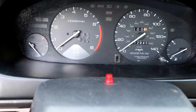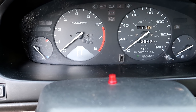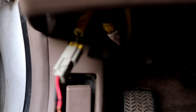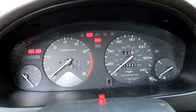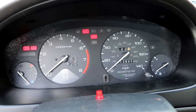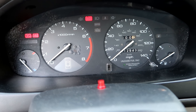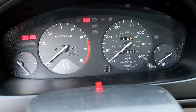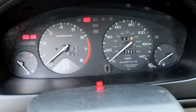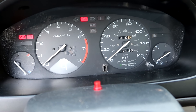You're going to want to do this fairly quickly — like within four seconds or so — as each step is required. So with it plugged in and key off, turn the key on and watch the SRS light. When the SRS light goes out, disconnect your jumper. The SRS light comes back on, you reconnect the jumper. SRS light goes out, you disconnect it. Then the flash tells you it is good to go.